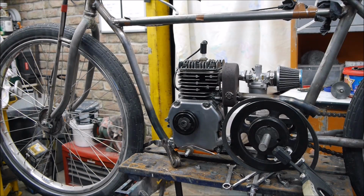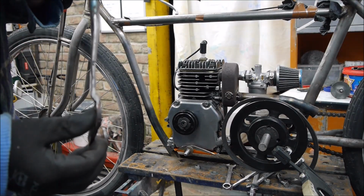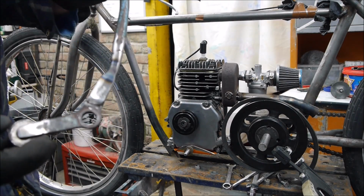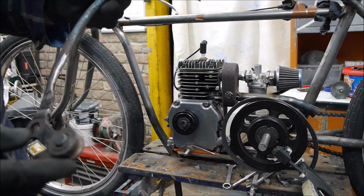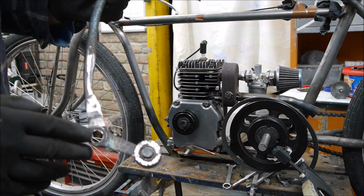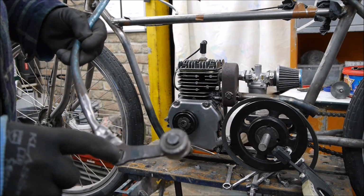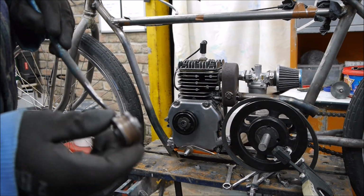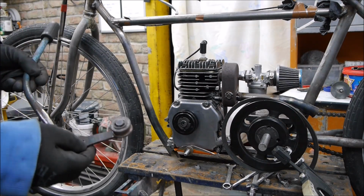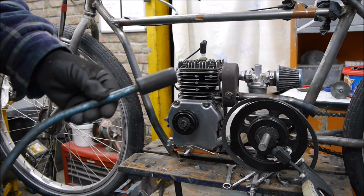So I've done a bit more work on this now, worked on this arm. I've basically put a step in the arm there to clear the actual pulley, and it's one of them classics where you start off with something, you modify it, but it's so far modified from what it was to start off with, I maybe should have made one from scratch. But as with a lot of these things, you need something to start you off with an idea. So this started me off with an idea of a sort of bell crank with a pulley, with a pivot in the middle. I've put the pulley on the end there. This was all sacrificed, or saved I should say, from the lawnmower, so that's on there. Probably needs a bit of work on it yet, and I might have to improve this because there's now a bit of play in here, I've noticed. And then this was the lever that I wanted to keep off the lawnmower gearbox.